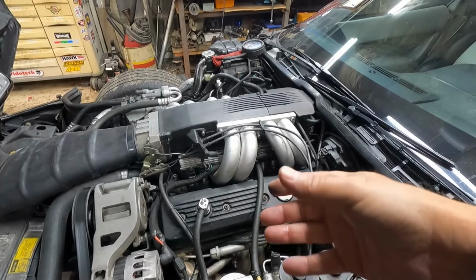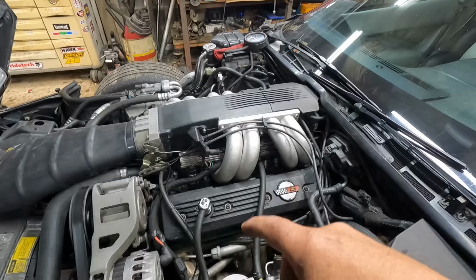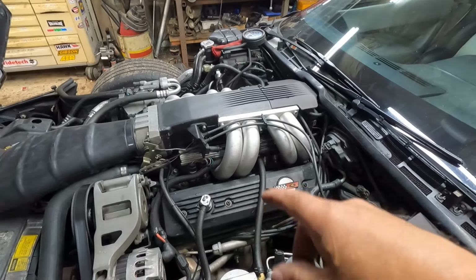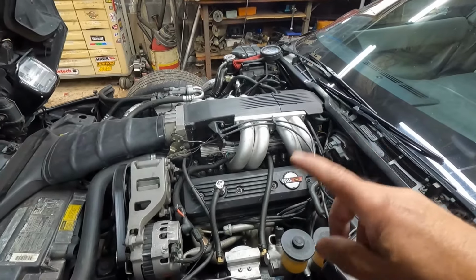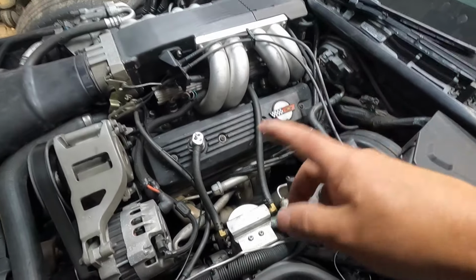And then when you go start it up, the engine warms up again, the PCV system helps draw all that moisture out of your crankcase, which is important, because that condensation, if it just keeps building up in there, it'll turn your oil to sludge, and you don't want that. But anyway, don't worry about this if your engine's stock. You don't need any of this.